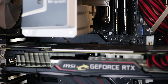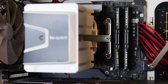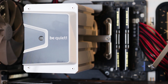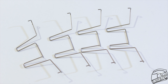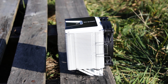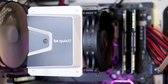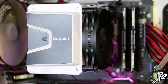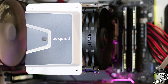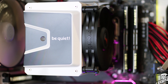One of the immediate issues present on this cooler is the exact same issue present on the regular Shadow Rock 3, which is the complete lack of space behind the heatsink for a second fan, even though Be Quiet has included an extra pair of fan mounting clips. This happens thanks to the offset design which, while it does increase the memory clearance, it also pushes the cooler so far back that a secondary fan would be almost impossible to install without creating issues, at least in a fairly large case. It's not a massive oversight, but it is something to keep in mind, especially if you're not using a bigger-than-average case.